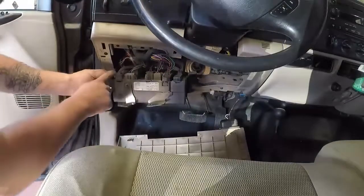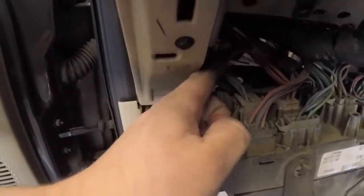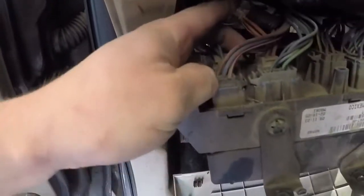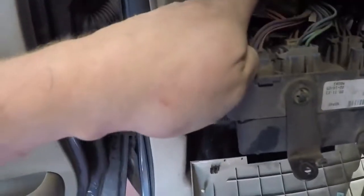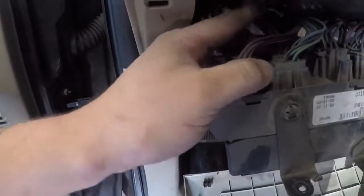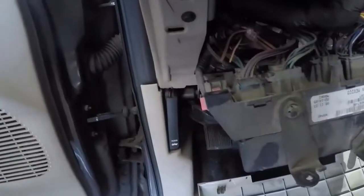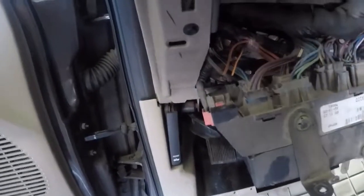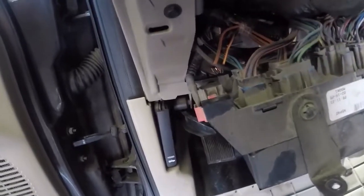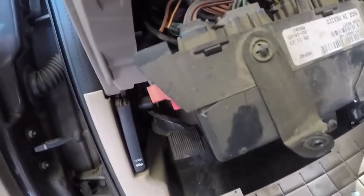It's nice and clean behind here. The cool thing about these Fords — there's a little cable pack in here, it's actually taped up and says AUX, AUX1, AUX2, AUX3. It actually tells you which ones to use. If you want to go 30-amp, the 30-amps are the big ones — that's an easy way to tell. The 10-amps are the small ones. I plan on putting more lights on in the front using the same switch, so I'll probably use the 30-amp. And I'll also use a 30-amp in the future to run my high idle.